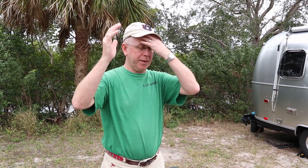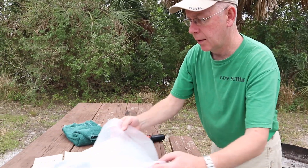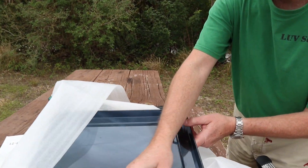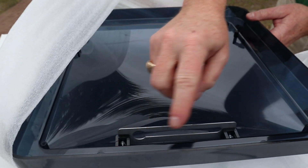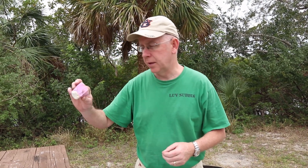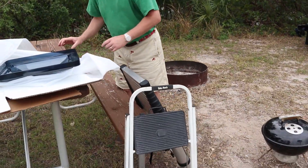Back in Melbourne we lost one of our Fantastic Fan covers — we opened it up, the wind was going the wrong way, and it snapped the plastic fittings. You can see how on this new one we ordered from Amazon, the bracket is held in place just by these plastic clips — if it catches wind, it's going to break those easily. We had a temporary glue fix but that has since departed, so we're now going to put the brand new one on. I've got my cup for screws, my electric drill, and the ladder.